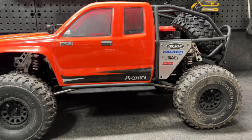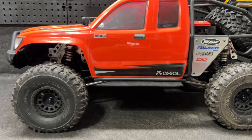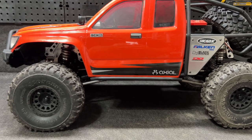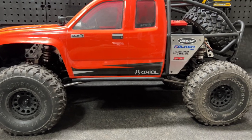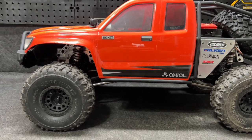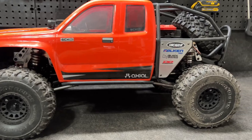We are ready to go. I did check the rear axle — the ring gear bolts were tight, but I did add some grease to it. The front end is ready. I also moved the shims on the rear to the ring gear side to tighten up the mesh a little bit. I did get some footage before I did this swap, so that's how I'm going to test the steering.